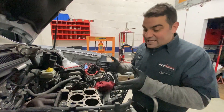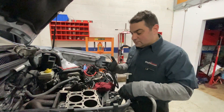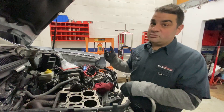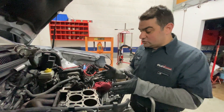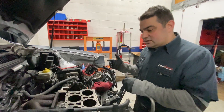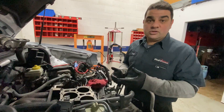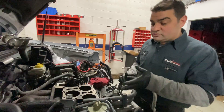The reason the head had to come off is because the R32s were never turbocharged. Because of that, the compression is higher. When you turbocharge something, you've got to bring that compression lower because you're going to have forced air coming in, so you have to put a head spacer in — and that's why the head has to come off. When we did the Golf R build and the Mark VI GTI build, they're already turbocharged, so the compression is already lower from factory. You're just adding a little bit of extra boost.